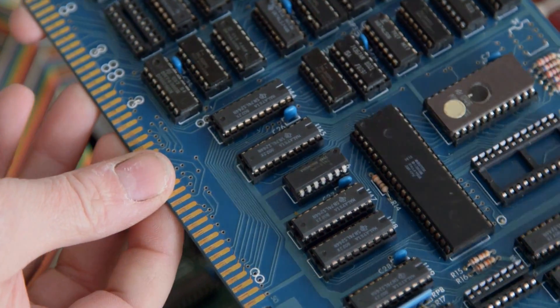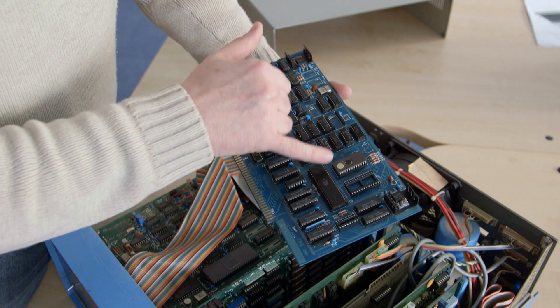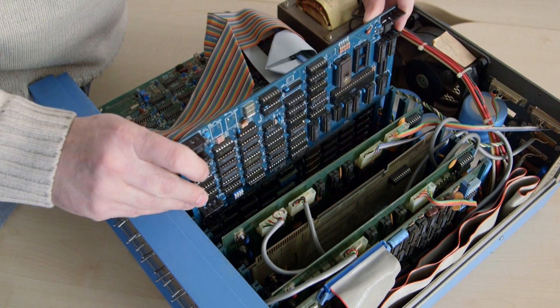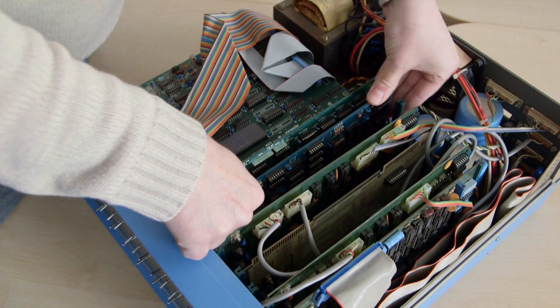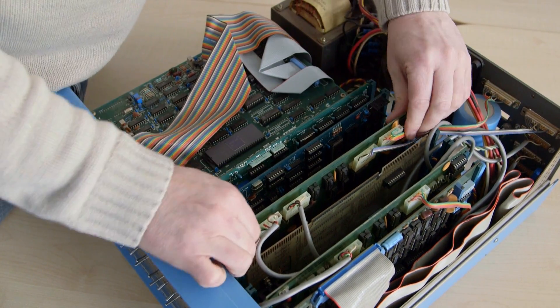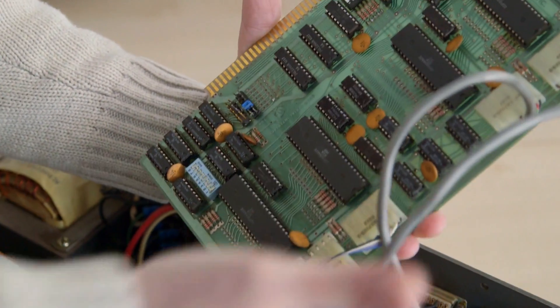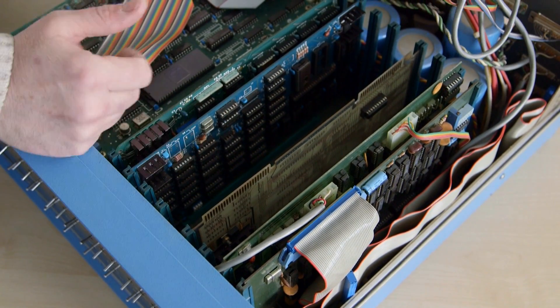So this is the CPU card from it. Like I say, this is a Z80 — a Mostek Z80 in there. I've got some sort of address decoding over here, and the ROM there for it. You wouldn't normally find a Z80 in an Altair, but this one's special. These other cards have 100 pins on the bus and they're quite hard to get in and out. This one is a serial I/O card, so this actually had probably a number of terminals connected to it — we've got four serial ports there, and another card over here with more serial ports, so you've got six serial ports hung off the end of this. It's possible that it was doing some sort of concurrent CP/M.